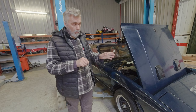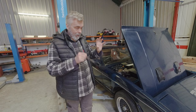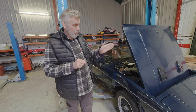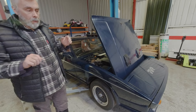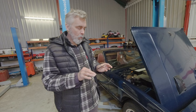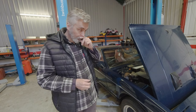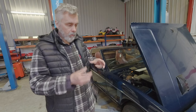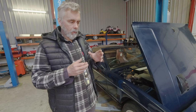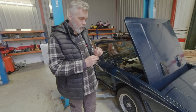So we're converting all the light bulbs to LED, and the 7-inch headlight units will convert to 7-inch LED headlight units — all CE certified and all the rest of it. We're going to put a junction box at the front, a junction box at the back, and one in the middle, so we can control all of these things locally. That means the overall wiring loom gets a lot, lot smaller. To control that, we're just using a little microcontroller — a little Arduino — one of the industrial ones used for plant control, agricultural machines, and industrial applications, which is used to being shaken around, cold temperatures, hot temperatures, moisture — so it's a good solid unit.